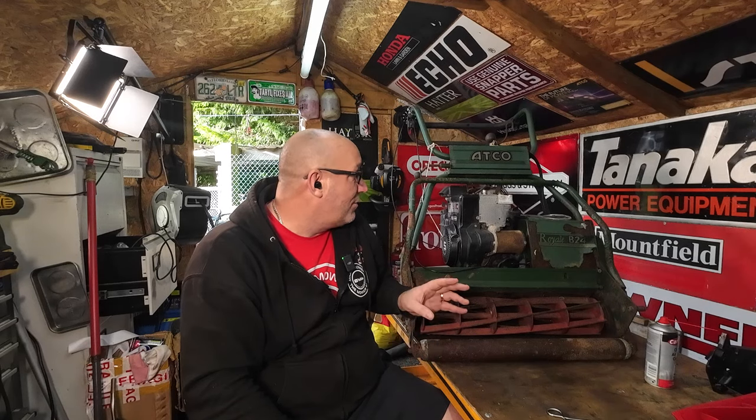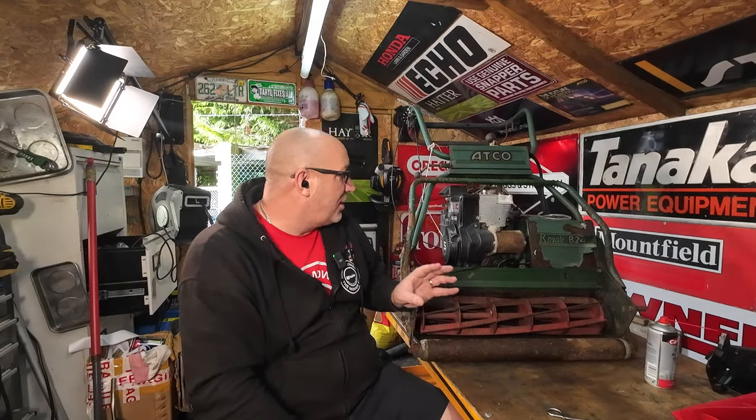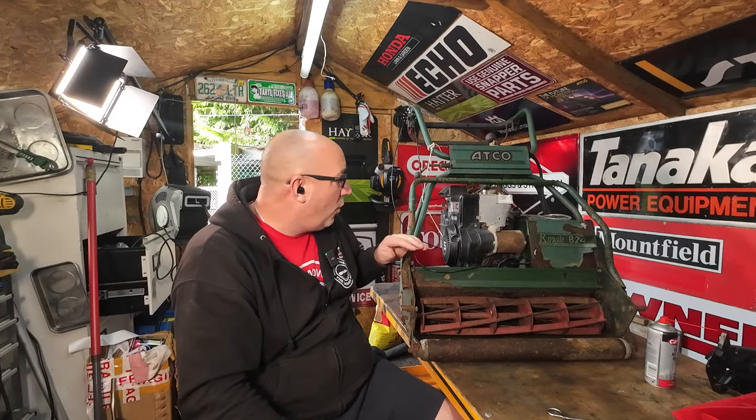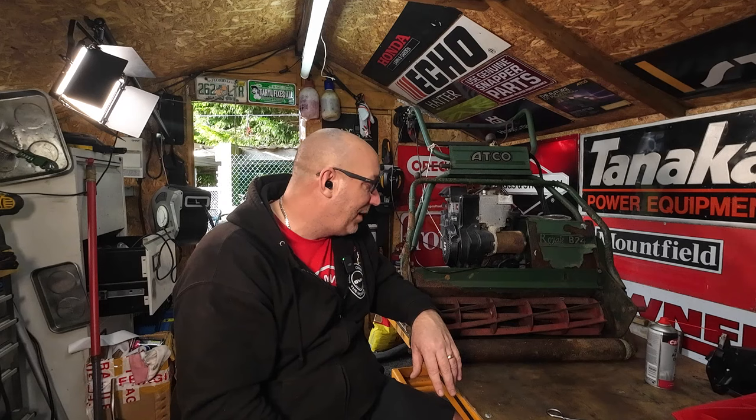So in this video, this may be a one or two part, three part, I'm not quite sure. The idea of the exercise is to get this machine up and running as it should do. But there are one or two other bits I need to do first. I need to do a carburetor clean, tank flush, I need to do a pull cord change, check the oil, possibly a new spark plug, all that sort of stuff. It's all got to be done. Not a full service, this is just a get this machine running, please, Mick.